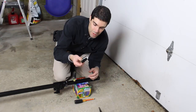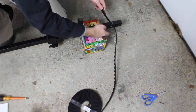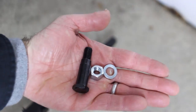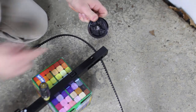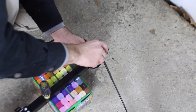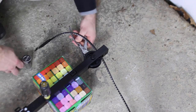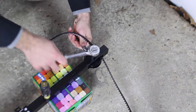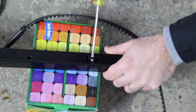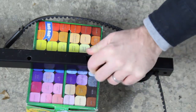Now you're going to install the idler pulley — it's this little pulley that looks like this and it's got a piece of tape on top of it. Feed the belt through that little window in the front rail. Make sure that you have about one foot of the belt in there. Then take the nut, washer, and bolt for the idler pulley — it should have plenty of grease in it, and if it doesn't, you should put grease in that little hole. Slide the bolt through and tighten down the washer and the nut using a socket wrench, making sure the idler pulley isn't going anywhere but the pulley still has some play in it. Bend that tab upwards at a 90 degree angle using a screwdriver, and if you need to, bend it even more using a set of pliers.